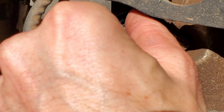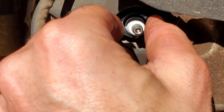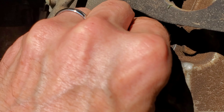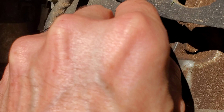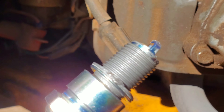Spin it in and out to distribute the anti-seize — you want all those threads coated so it doesn't weld itself in there. This is pass one, now pass two, and after two we'll pull it out and take one last look. Look how evenly distributed that is — that's what you want. Then we'll spin it in for the final time and torque it tight.